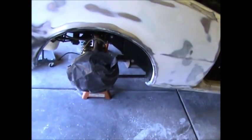Hey fellas, all right, the lower portion from the body line down has an 80 scratch on it, and it's ready for 110 or 120. And the upper side has an 80 scratch on it, and it's ready for a 120. And then we're going to start down there on the lower one. We'll tape off the body line, and over on this side, once I do that, lower in 120, we're going to start with this in 80 and see if there's anything wrong with it, and if not, then this quarter panel's done, except for the wheel well. I got to smear some mud on the spot welds in there. So when I get more, I'll turn this back on. Thanks for watching. Later, guys.